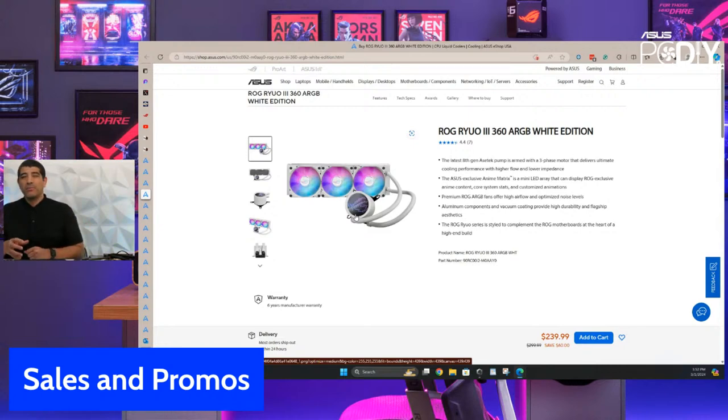So it really would only be if you're using more professional applications that you'd have to consider that type of heat dissipation requirement. In that respect, you can readily cool even higher-end parts, even overclocked, with a 240 millimeter or even our high performance tower heatsink. And we've shown that in our prior streams. If you want to check out our AIO demo, which we've done with the 12900K, the 13900K, and the 14900K. Okay, so just some feedback on that.